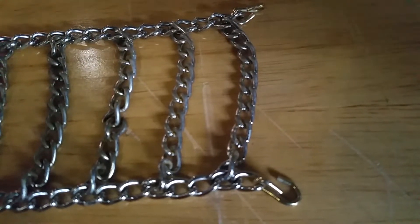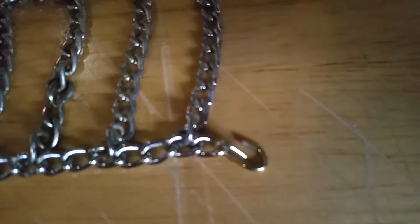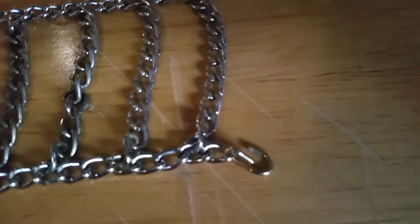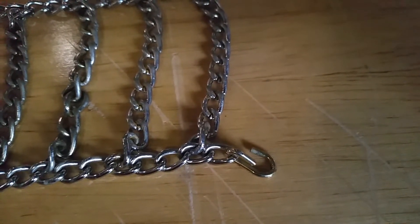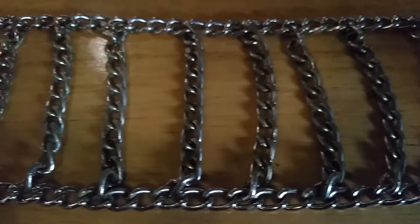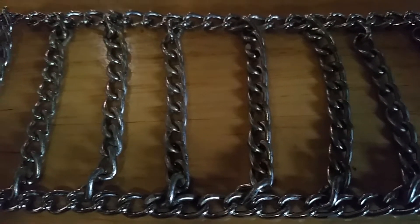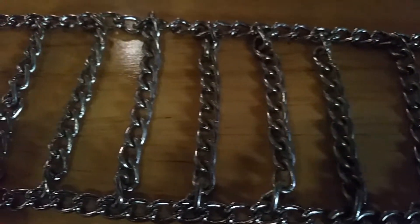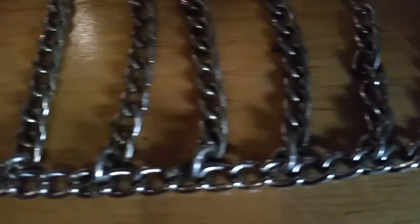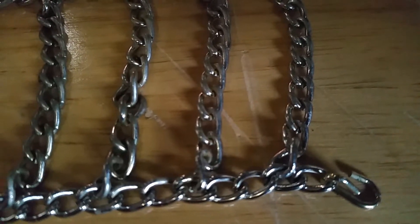To make these tire chains, I bought two sets of chains. The gold ones here at the end are the twisted chain — you can see I have an open end and a closed end. I ran them all the way down and it's ten links center to center. I ran it all the way down and then left one link open at the very end so that I can connect the gold link at this end.